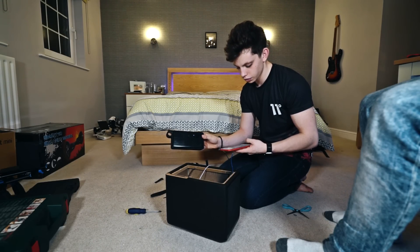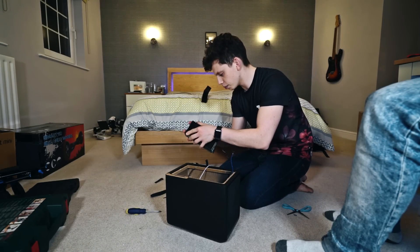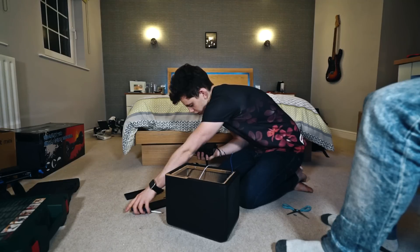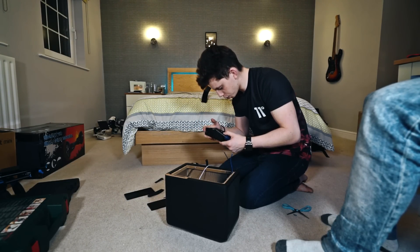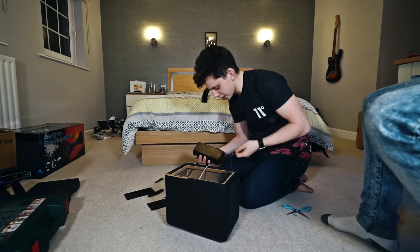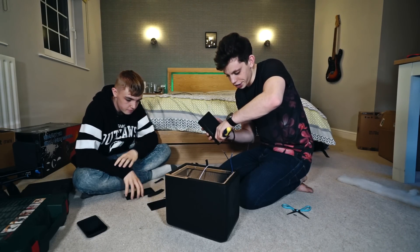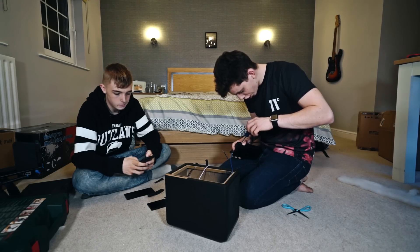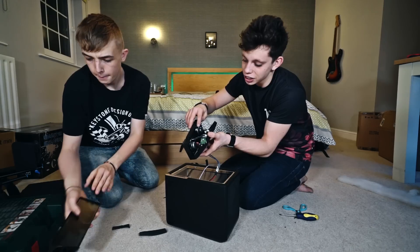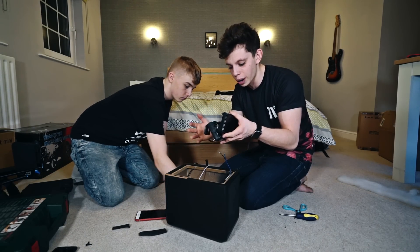That's what we're sounding like at the moment. Right, so that works. Now let's try and take this thing apart — turn it off first before we rip it to pieces. We take off the metal plate on the front which reveals the subwoofer and two speakers. Now we can put our screwdriver in here and take all of these apart — this is where we'll see if we're actually going to be able to do this. The cables go to the two speakers either side. The sub in the middle is actually a fake — it's just a radiator; it just vibrates the air already inside the cabinet. So we're going to disconnect the two speakers from the front plate — that's really all the front plate was, just two speakers.